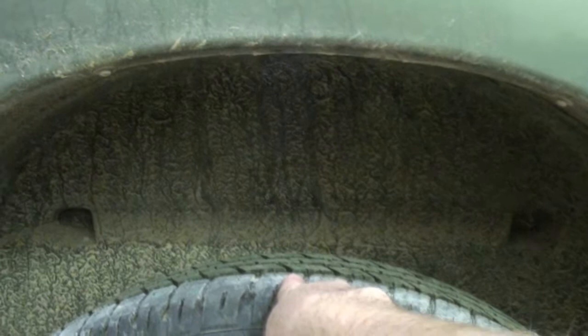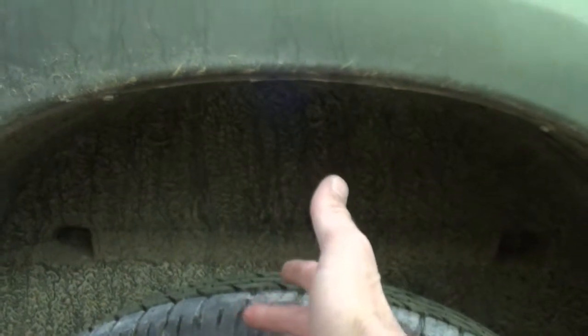But either way, if you take this measurement, then you either air your springs up, load the truck, or load the truck and then air your springs up. Basically where you want to be is you want to have this measurement the same. That'll keep your ride height the same with your load. So you can simply do that with just a tape measure. Not a big deal. Real simple, just get them set up.